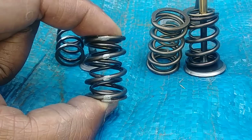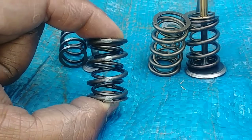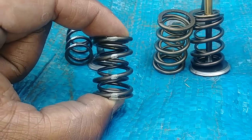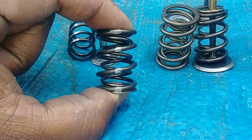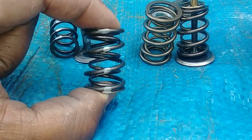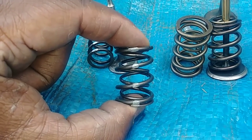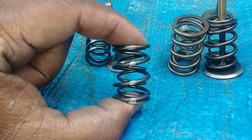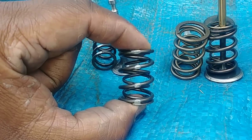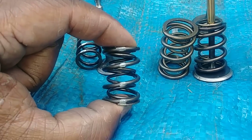So if I install it at a 1 inch 020 install height, that's 40 pounds, right? But I normally install it at exactly a 120 install height, right? So I can run at a 120 install height, it's about 42 pounds closed, right? So I can run the most common, say, would be a 308 dyno or a 310 mod, or even the Isky 315s or the Isky 330 with 1.3 roller rockers, right?